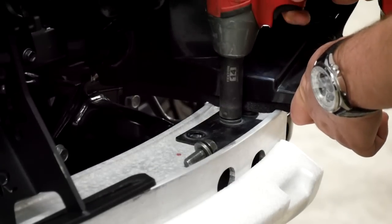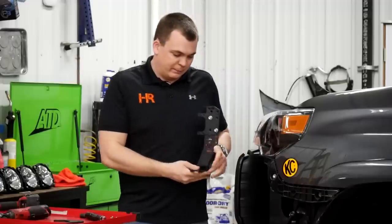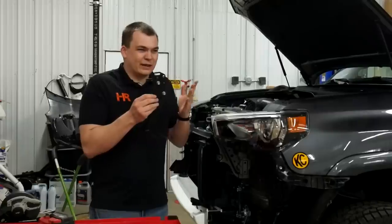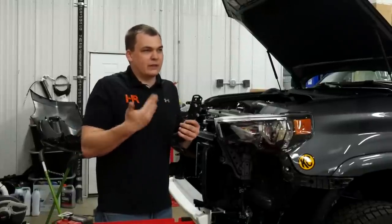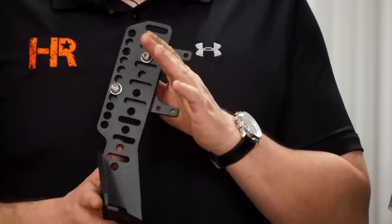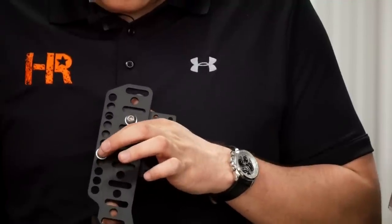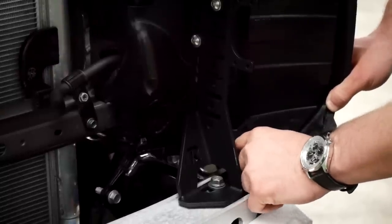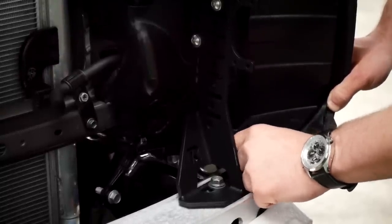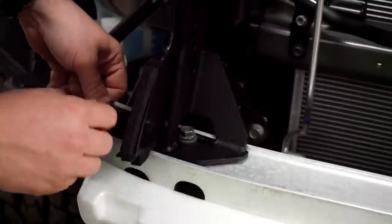When you've come this far in the install, you've got three bolts per side right down here — pop those out, reinstall them through the bracket and it sits in place. There's a lot of adjustability here. For the KC Highlight Pro 6, I went to the second hole down and then the seventh hole down — they're kind of kitty-corner, and you can put all four bolts in without any problems. Don't tighten anything right now, just snug it up finger-tight so you can move the brackets around and get the bar perfectly positioned after the bumper's installed. Repeat these same steps on the passenger side for the other bracket.